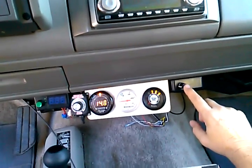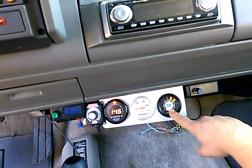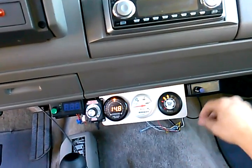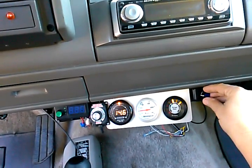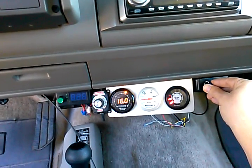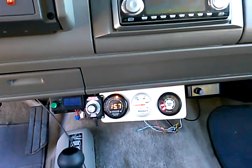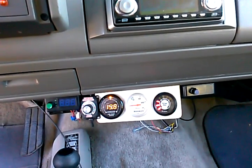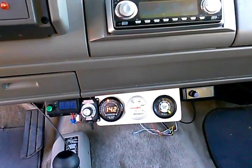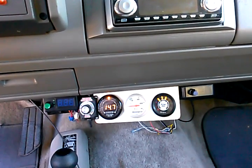What I'm going to show you: this is a map adjuster. Everybody sells these things. The O2 sensor has a direct effect when you adjust it. Now watch — I'm going to lean it out, and you're going to see that the air fuel ratio is going up: 16, 17. Let me go ahead and just get it up to about 16.2. Within seconds, the computer will figure it out and put the air fuel ratio back to its normal parameters.